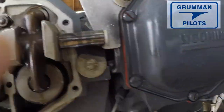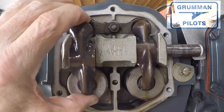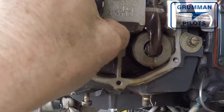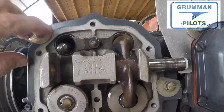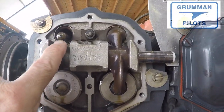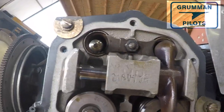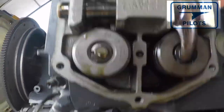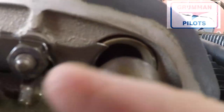You can take the push rod tubes and remove all that hardware. You also want to remove all the baffle bolts — the rocker cover is off as well as the gasket. Once you get down to the lifter bodies, we're going to be bleeding the lifter so when they go back in we don't have to worry about that. Once we have the rockers and push rod tubes all removed, we'll go after the cylinder base nuts, loosening the eight of them in a certain pattern. The intake is off, the exhaust is off, as well as the oil return tube and the primer line.